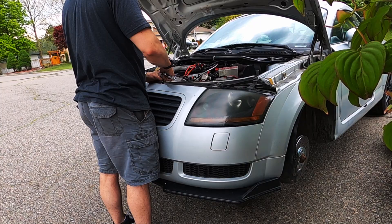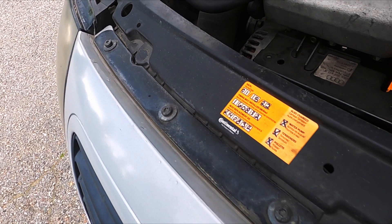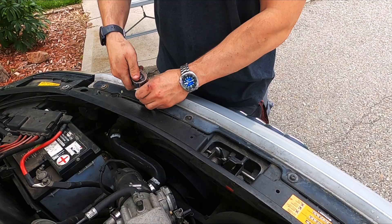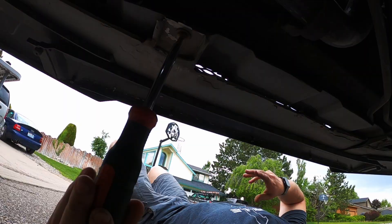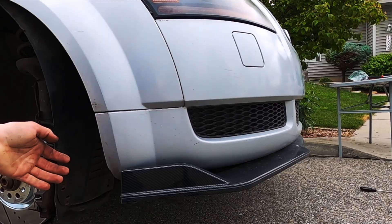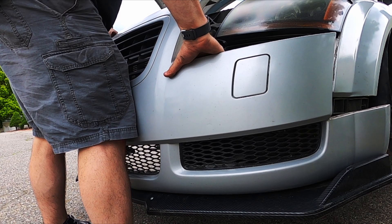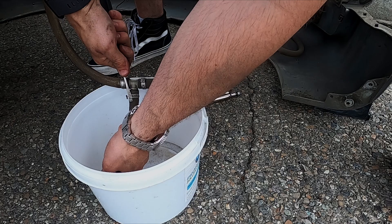The next bolts you're going to want to remove are the ones on the top of the bumper on this little metal rail. They're all Torx bits and, like all the other bolts in this process, they are super easy to get to. Once these bolts are off the top, on the bottom there are two Phillips screws, and that's it. A gentle tap on each side will dislodge the bumper, then you can grab it from the top and slide it on out. Some of these cars came with headlight washers, so you won't be able to move the bumper very far until you disconnect that system. This is the only thing you will definitely need to delete when installing a front-mount intercooler, so keep that in mind.